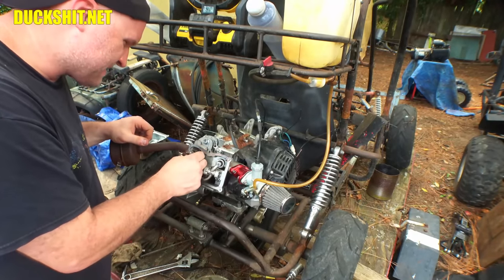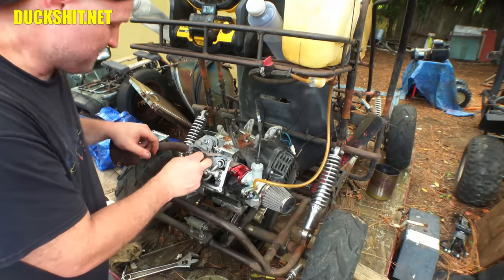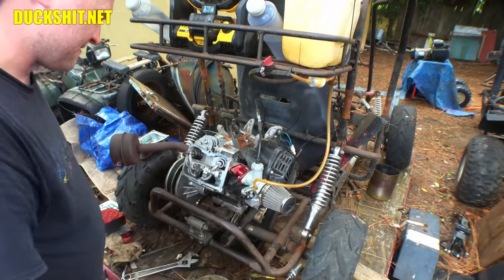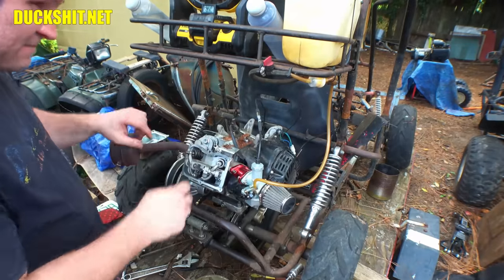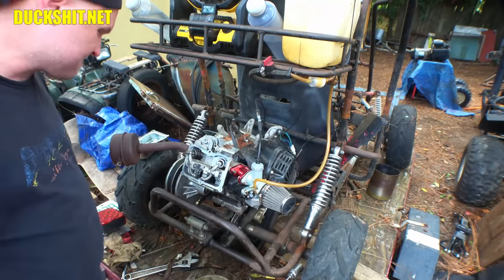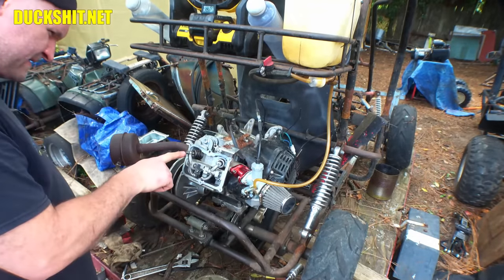And this one, when I slip it in on the exhaust side, it is super tight. So clearly, it's too tight. And the intake side, I can't even get it in there at all. So we need to loosen up these adjusters and then just simply make adjustments on them. I mean, it's not that hard. You guys have seen me do this on Volkswagens a million times before, so we'll do the same thing here right now.